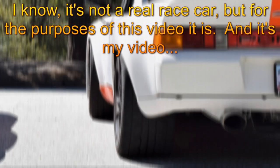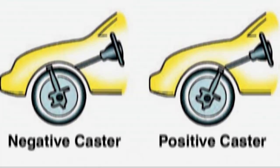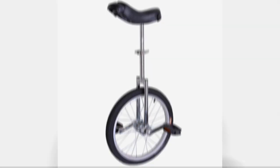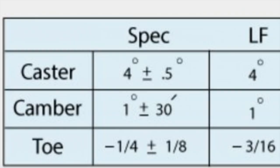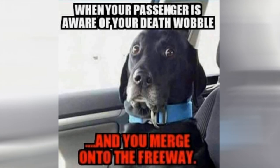And then there's caster. Think about a unicycle and a Harley chopper. The unicycle has zero caster — it's straight up and down. The chopper has 30 or more degrees of positive caster. Most cars will be in the 2 to 8 degree positive range, and it's a pretty large range of acceptable settings. Caster being off causes the car to pull to one side, or too little caster in vehicles like my Jeep can cause death wobble.